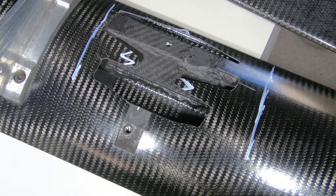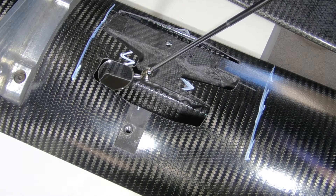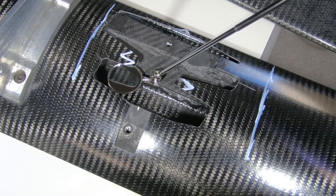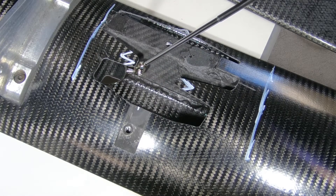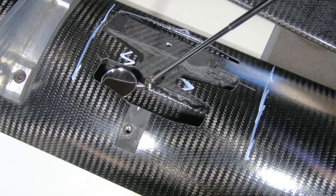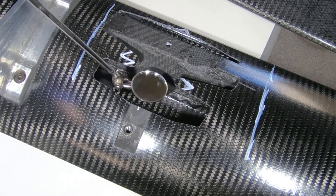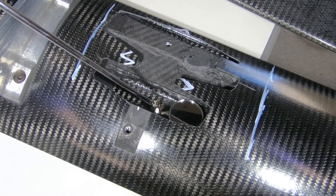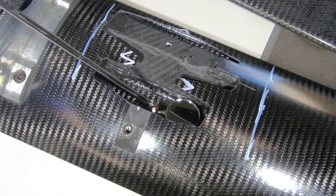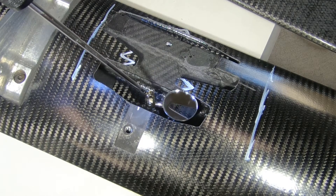Just to inspect the underside of the wing to make sure we don't get any delaminations, just use a quick inspection mirror like this. It costs about $5 from the local hardware store and you can see the underside of the wing is actually being scuffed up. You just trace the whole wing surface around and make sure you can see it all. When not filming there are no really bright lights directly on the wing, so you've got to use a different light source in addition to your mirror. If you have your inspection mirror in one side, just take a really cheap flashlight, shine it straight down there so it bounces off the mirror up to what you're looking at, and then you can see everything a lot better.